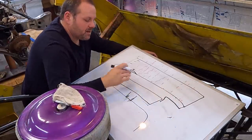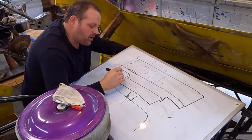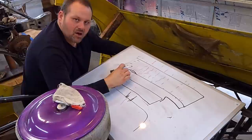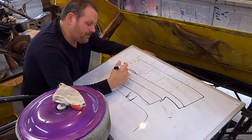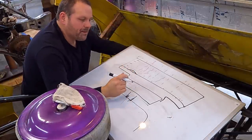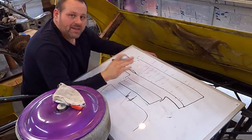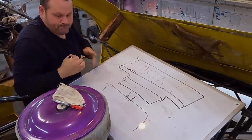Nothing's perfect. If we get the layout, it looks good, and I'm 3/4 inch, or 1 inch, or 1/2 inch, or anywhere in that zone on that front half of that fan, I'm happy. If we end up a little bit deep and the whole fan's in there, we'll take it off and trim it back. But that's our plan, that's what we're gonna do. So let's physically do it. It's really not that hard.